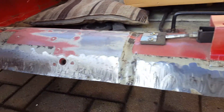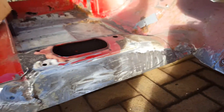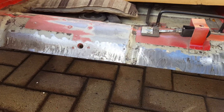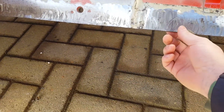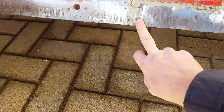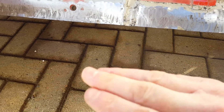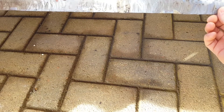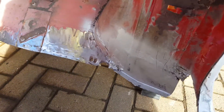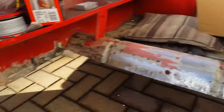The centre tunnel here — as you can see, I've taken away most of the surface rust that was on it. I lined off with tape, took it back as much as I could, and I've cut some of the section of the floor away. I've got an air tool — a flanging tool and an air punch in one — that I'm going to use to reshape this, and I'm going to attach the floor with an overlapping joint, plug weld it on top to give a bit of extra strength, and seam weld along the underneath.